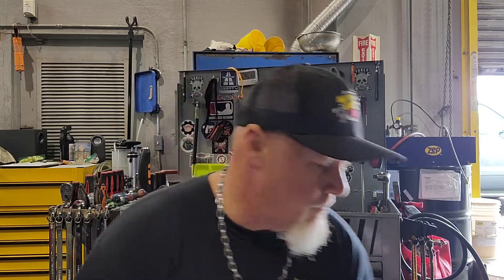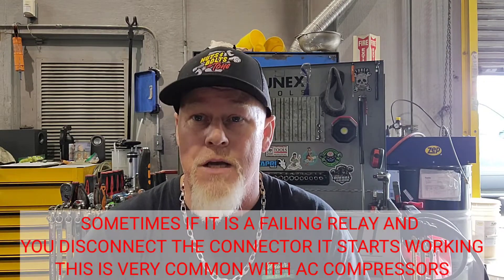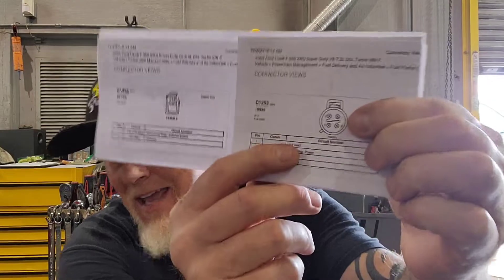A 6.0 and a 7.3 operate in the same way — it's just a different fuel pump. If you have this code, first of all, before you replace the fuel pump, try to get it to act up. Then go in and check your pink and black wire. If it's a 6.0, back-probe the pink and black wire there — don't disconnect the connector. A lot of times when you disconnect connectors of electrical components, you're not going to get the proper signals. When there's no load, you're just not going to get the right testing results. It's best to back-probe the wires. A lot of younger guys will disconnect the connector and check it and say it's got power, but as soon as you plug it in, the load brings it down and it doesn't have enough power — so you're just chasing your tail. If you have the 7.3, back-probe the pink and black wire there. If not, just go straight to the pink terminal — the positive terminal on the fuel pump — and if you don't have power, let's move on.